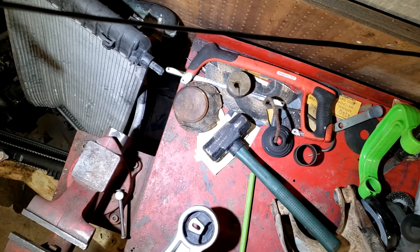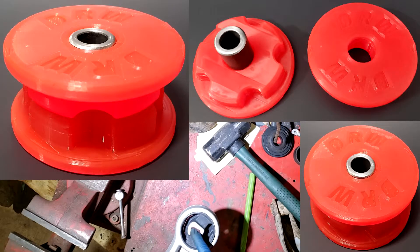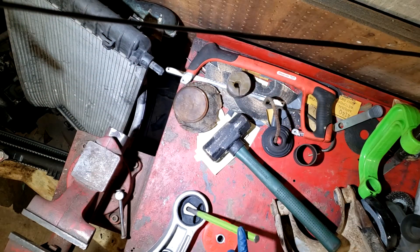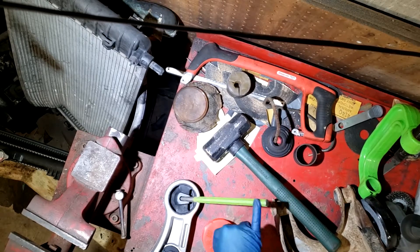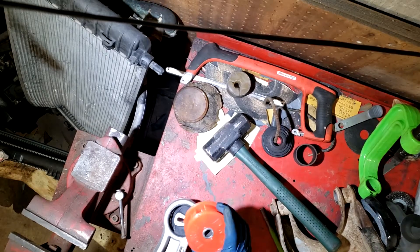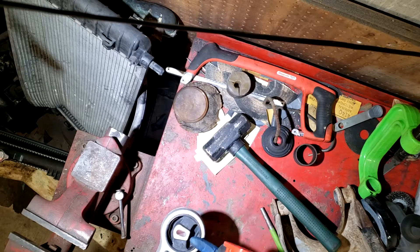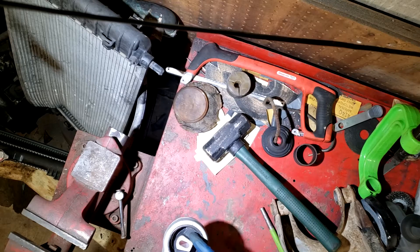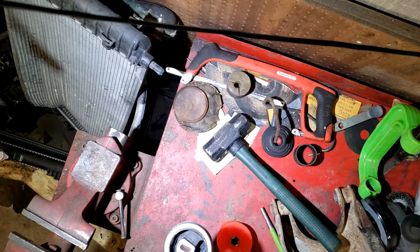I have made a solid polyurethane replacement bushing to put in here that will add rigidity and make it last a lot longer than this flimsy one. You can see just with a pinky I'm able to completely flex it all the way to the side with no issue at all - super duper flimsy. This polyurethane replacement bushing will greatly increase the rigidity of this mount and prolong its life versus one of these regular rubber ones.